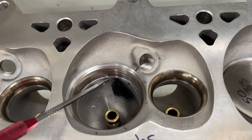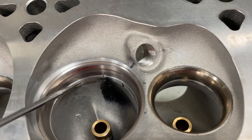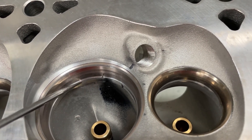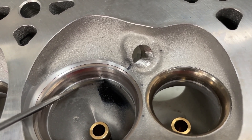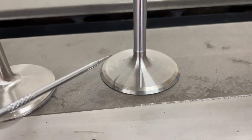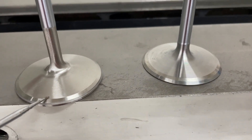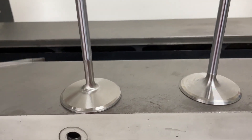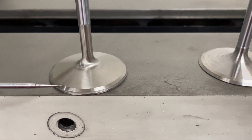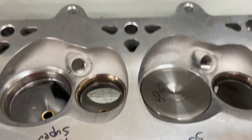I'm going to flow each of these after I take out this ridge. What I'm going to do is not enlarge the throat at all - just take a cartridge roll and blend this out so there's not a line there, because I think that's a fair comparison. It'll still leave all the angles, just going a little bit down into aluminum to clear it. I'm going to flow with two valves - this stock LS valve with a 45-degree seat and 30-degree back cut, and the Freya valve which has a 45-degree seat and 33-degree back cut. You can see the difference. So that's the 45 - let's look at the 50.